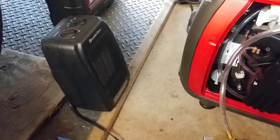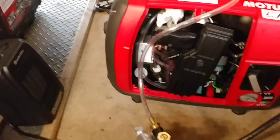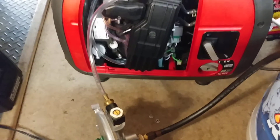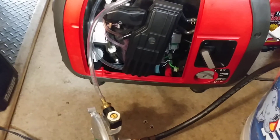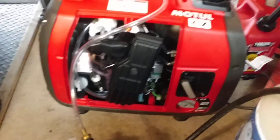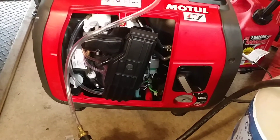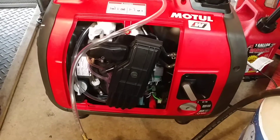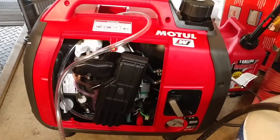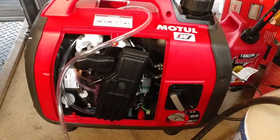I had a 1500 watt and another 500 watt light there to do some load testing so I could adjust this properly. To start the engine, I put eco mode off to run it on propane — it didn't want to start very well with eco mode on when cold from propane. So turn eco mode off, start it, and then turn eco mode on as needed.